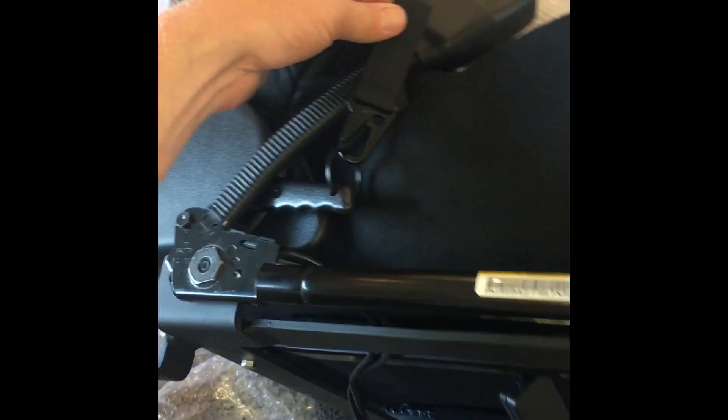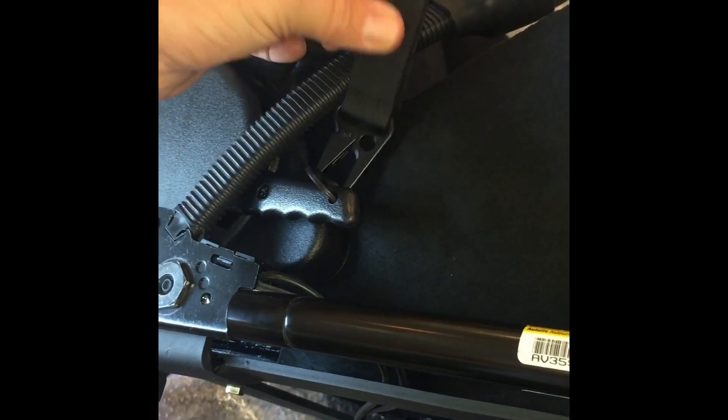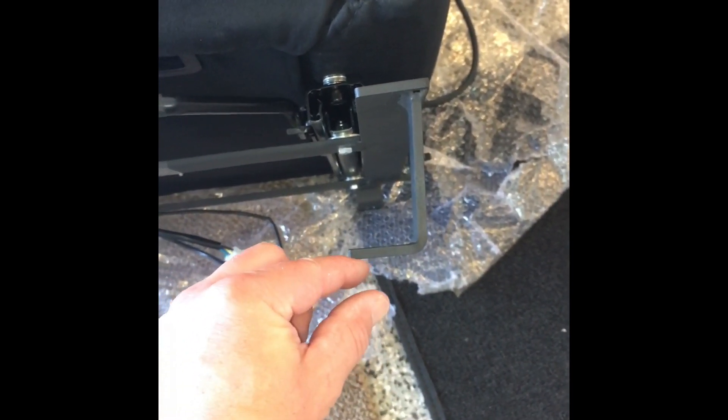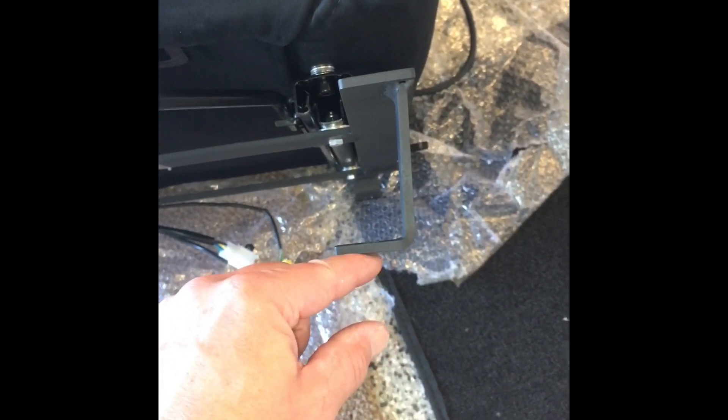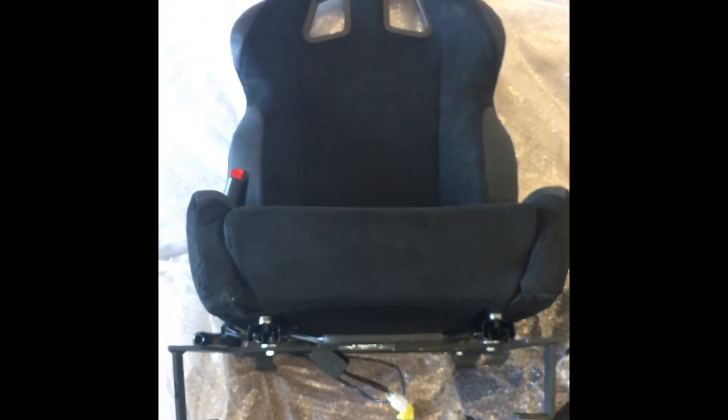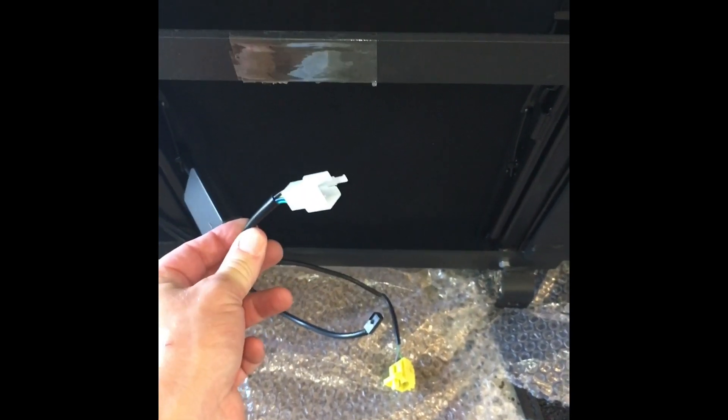For the latch — because you're basically not able to reach the latch — I put a tether on it, drilled a hole. This tends to fall down anyway, so I've got to find a way to keep it accessible. I shimmed up the front for a little rake: six M8 washers in between the bracket and the seat on each side, and then on the feet I put two 5/16ths and one 7/16ths washer in between the floor and the feet. On the driver's side I'm doing four, on the passenger side I did three. We'll see if that needs to be adjusted.